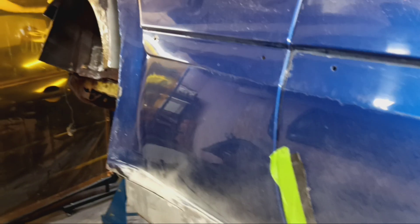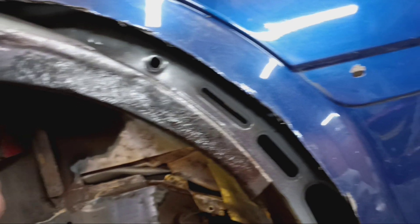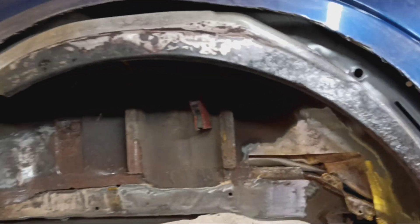Standard three-door seals up to the back where it obviously flares for the rear arch. Got the worst of this chopped out now, chassis rails cleaned up just to make sure it's all sound, and still got these edges to cut out and make good. That was all kind of ready to go — the arch itself actually is still solid.